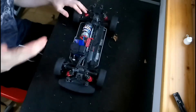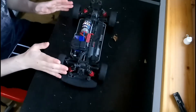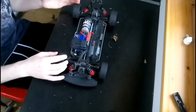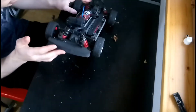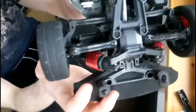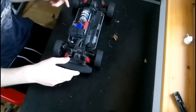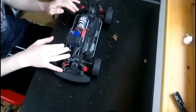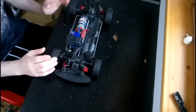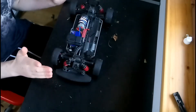No matter what you're doing on-road, you want a fast servo. Off-road you can get away with slower servos, but on-road you can't, because you're not drifting about in dirt. Traxxas has done a really good job with this servo — there's a little metal bit where you can tighten and loosen it, and there's a spring that puts more or less spring on the servo. With a fast servo, you'll be able to turn corners a lot quicker, it'll be a lot more responsive, and you'll have a lot more control over the car overall.